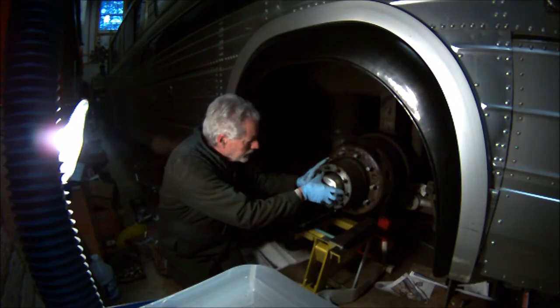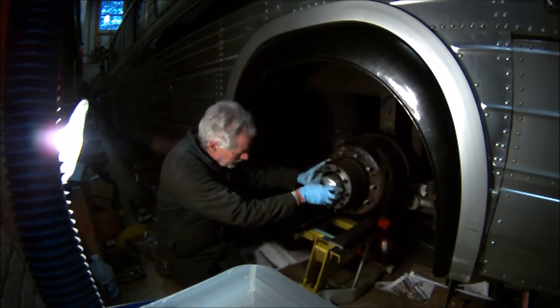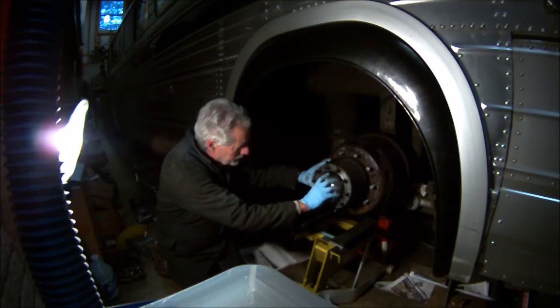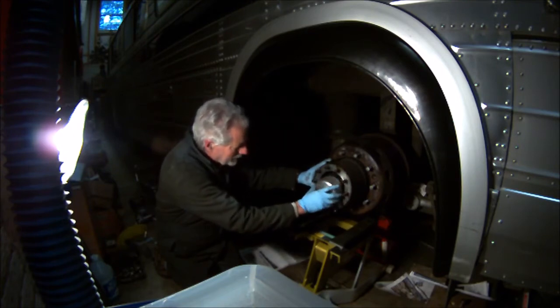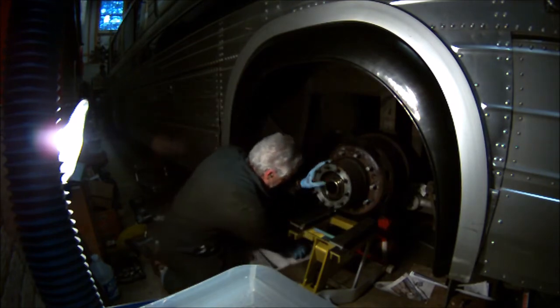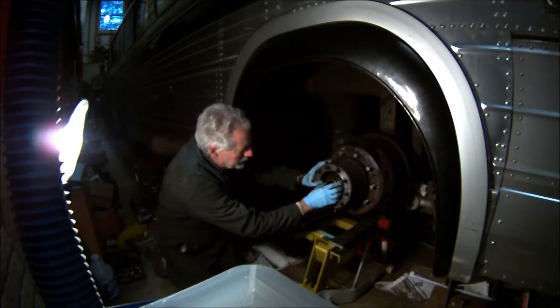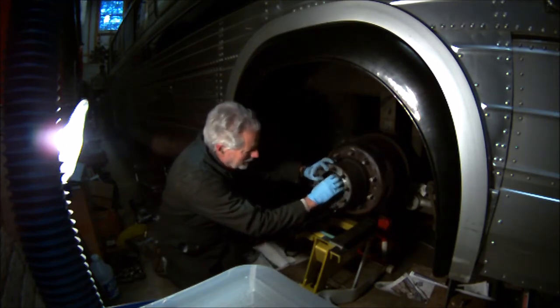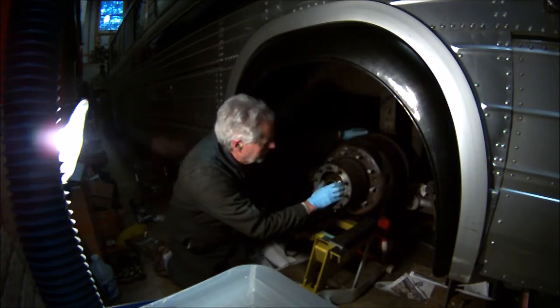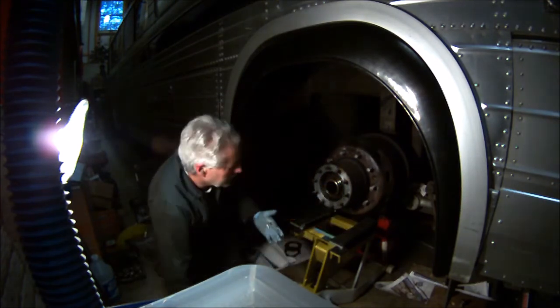So we got the adjusting nut just about ready to come off here. Got our jack positioned underneath. One thing you ought to try not to do is let this bearing slide right out of here if you're not careful, and see, there it goes already. Have a clean place to put your tools and your bearings and whatnot, so that they don't get dirty.